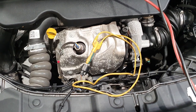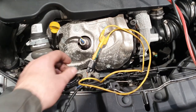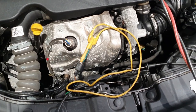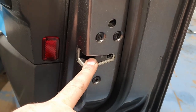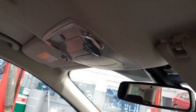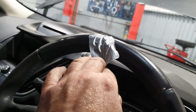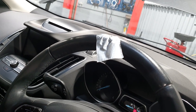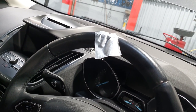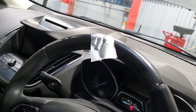My method is to roll all the door locks to simulate the vehicle being completely locked up, while still having access. I've bypassed the bonnet switch and rolled the catches on both front doors and the tailgate. I've also put some tape over the ultrasonic sensors for the alarm, and a bit of tape on the steering wheel to remind me the sensors are covered — I have been known to send vehicles out with the tape still on. We'll lock the vehicle up, see what drain we've got initially, and go back in about 40 minutes.